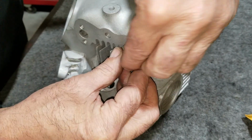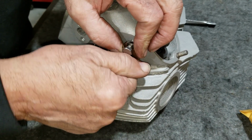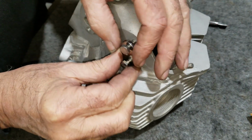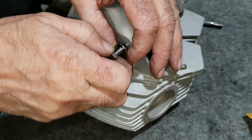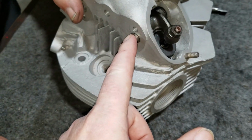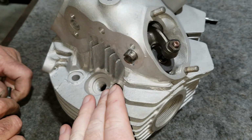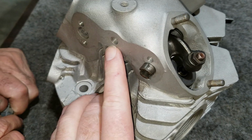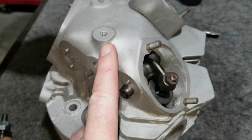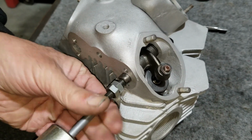Now all I'm going to do here is make sure that I'm square. What I mean by that, if it's turned, I wouldn't be able to start this. So I'm sitting in a pretty good spot right now. These threaded holes here are 1/4, weren't they? Yep, 1/4. And then there's special threads in these heads everywhere. We've got like 26 thread, which is hard to find taps. So don't be just running any old tap in there. It's 26 threads. Don't run a 24 or a 28 in there. This is 26, and those are 26 as well. That's like the British thread, sometimes called cycle thread.